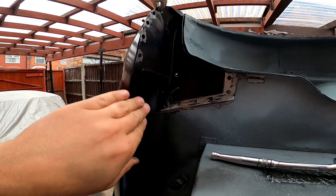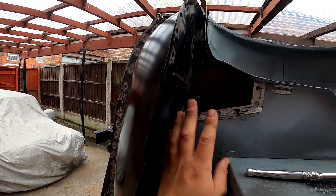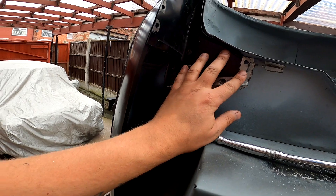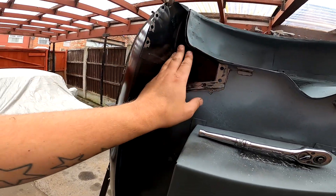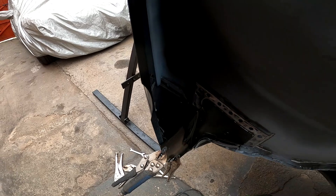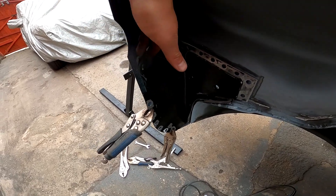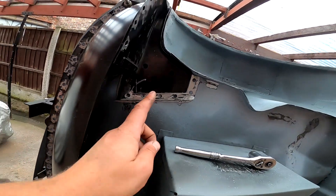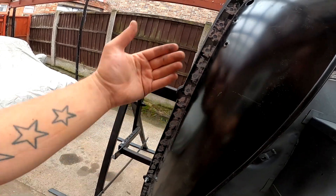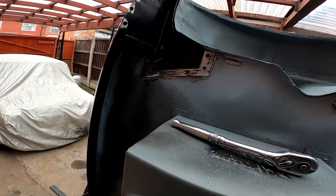You can kind of see where I'm going with everything. This is on temporarily - I just want to get these tacked in or pretty much welded top and bottom, then I can take the valance off because I know these are in the right place. So we continue to clean all this off, it's going to need a few tack screws to just pin it all down. It all lines up pretty nicely. I'm going to run a stitch up the back of the valance there instead of plug welds - I know it can get nice penetration and add a bit of strength back into the car.